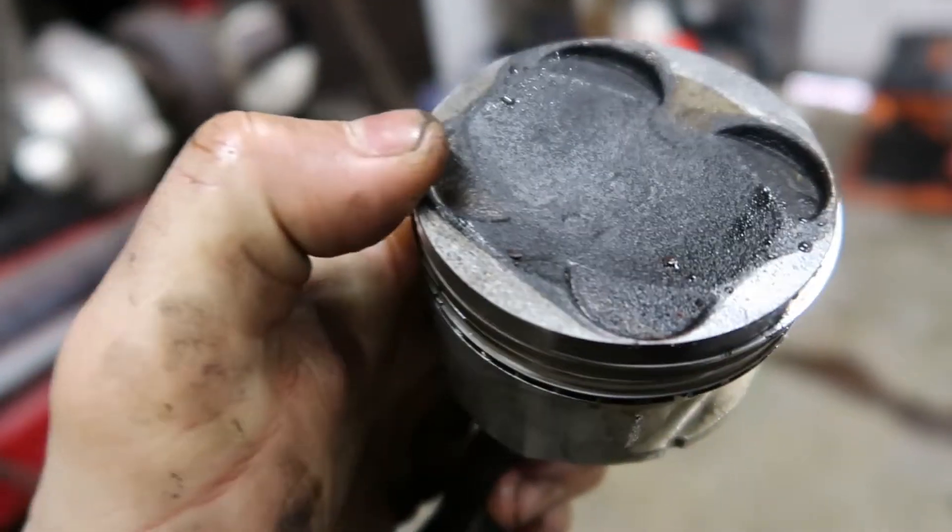There is not really much of a shell left here. She's definitely wrecked. You can see the remaining parts of the shell. The crank looks pretty messed up too. But I've got a lathe now — it'd be interesting to see if I could polish that up. Folk are gonna be cringing right now watching this — that's like a no-no. But gotta remember, this is a pretty rugged engine. This is hideously done. Check the lip on that — both sides. The bearing has been spinning in here and it's been wearing down the actual conrod. And under further inspection, the ring land is also cracked.